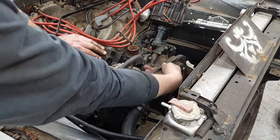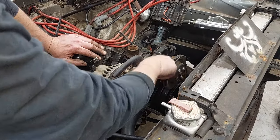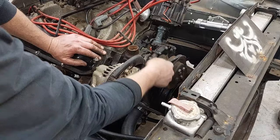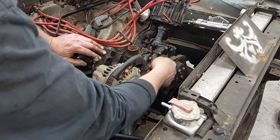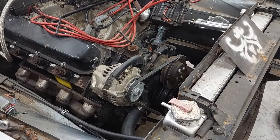I was taught that when you're installing a belt, you should be able to roll it sideways fairly easily without too much effort. You have to put some tension on it, get it like that, but it shouldn't — you can snap it a little bit. There's a little bit of play there.